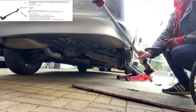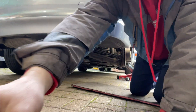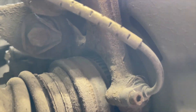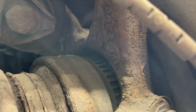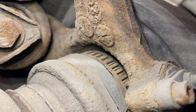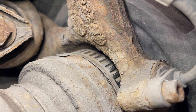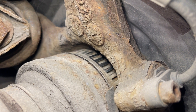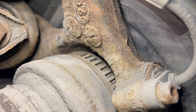Dropped the handbrake down, got this great light to keep it lit up so I can see what we're doing. Let's come under and have a look. I know on this one there's an issue because I can see the ring there, and if I turn the wheel you can actually see the high spots on that ring where it's catching the sensor - you can see the difference in the color where it's catching it, just there. That is right where the sensor is catching the ring and throwing it all out.